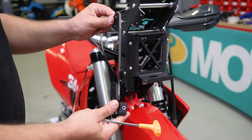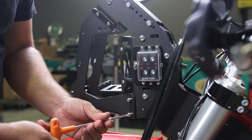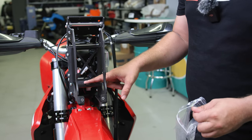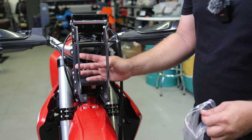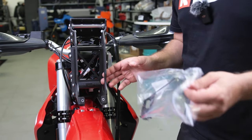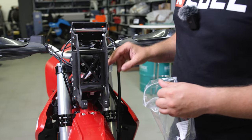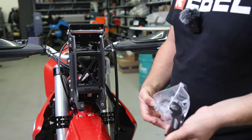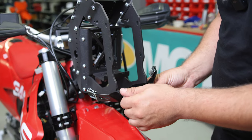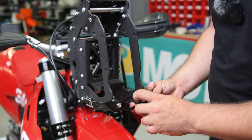Once you install the tower, get the headlight bracket and place both sides on. I should mention I skipped one step at this point, which is to remove the Erie Track emergency kit bracket. My advice is to first fix all the wires properly and remove that bracket before you install the headlight brackets, then go on to installing the retaining bracket for the windshield. When you install this, tighten it only by hand and leave it a bit loose because we'll tighten it after we install the headlight.